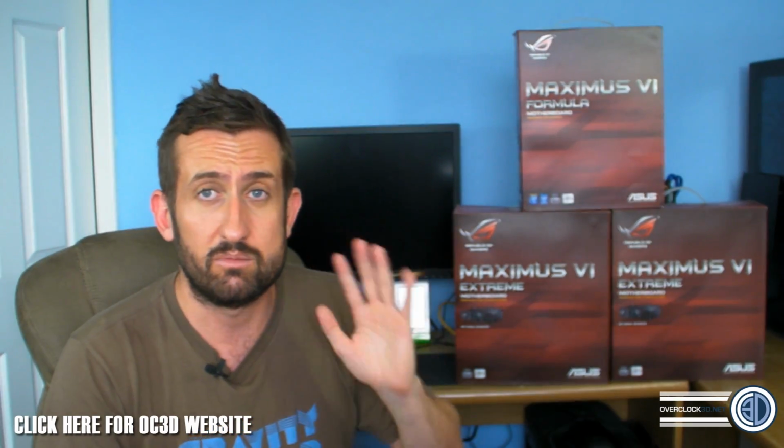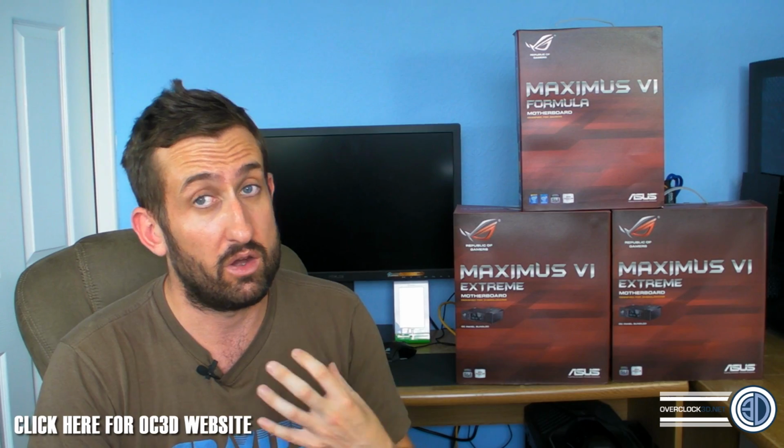And I just want to stress that every single one of those boards will get the most out of your specific CPU, because you do need to remember the silicon lottery, and that's the most crucial thing here. With Haswell, when you start to overclock them and push the volts, the temperatures rocket. Even with an H100i and 12 volt fans, I'm still hitting above 80 degrees, and I mean way above 80 degrees, even running voltages of like 1.26 volts. And I know I'm lucky. I've got a very, very good CPU that will do 1.26 and it's stable at 4.9.